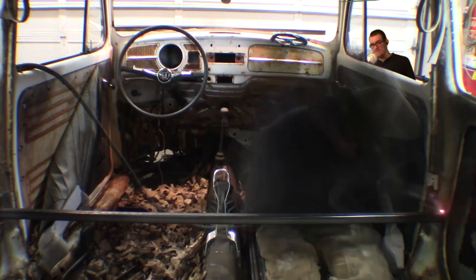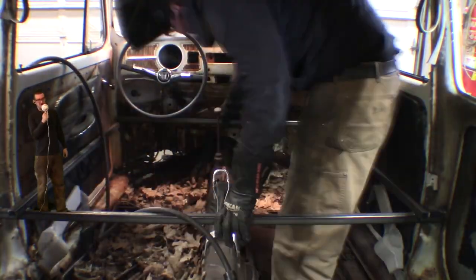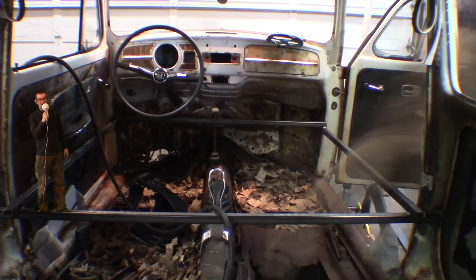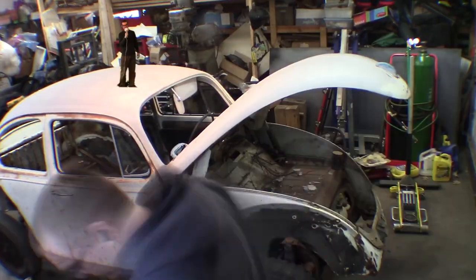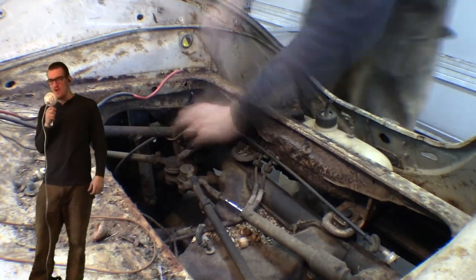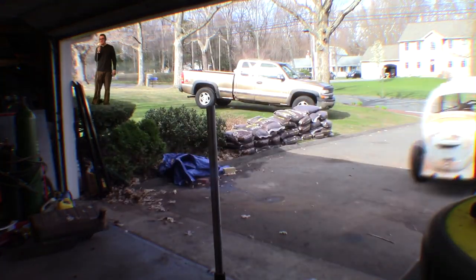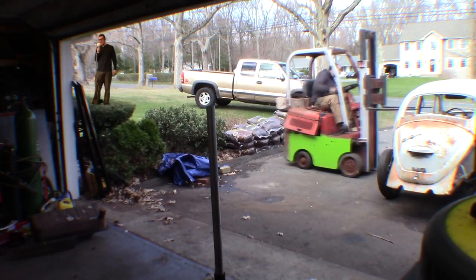Now that the beetle's in the garage, I have to brace the body. I ended up doing only four braces across — four braces is gonna be enough. The way the beetle's designed is it's a split pan, so the body comes off the frame and all the structure is underneath. All it takes to take the body off is a handful of bolts, a few hoses, two wires, and the steering.